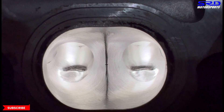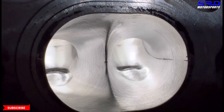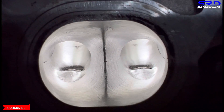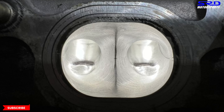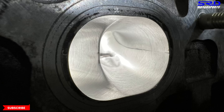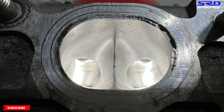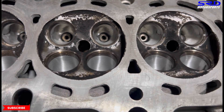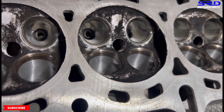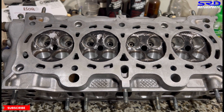Let's get closer with better lighting. The hardest part here is from the valve seat, keeping it as round as possible all the way through past the guides until they merge together. Once you achieve that, you're improving the port speed, which is good for the exhaust. Look at that - it looks really really good. Light doesn't lie - you can see the contours by the light. Now let's check on the chambers - we're going to clean this up, and you can see the intake bowls are almost perfect, even the exhaust bowls.